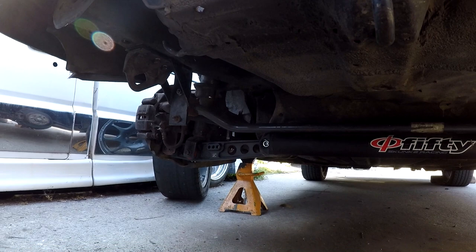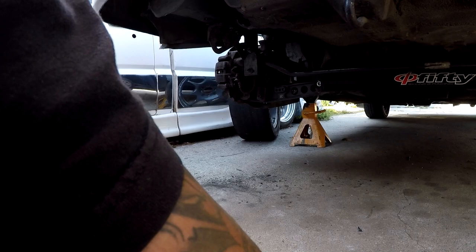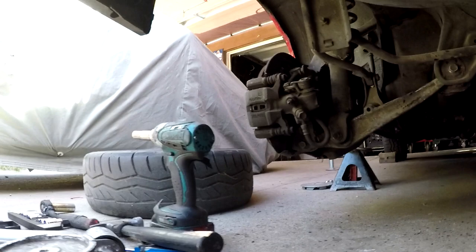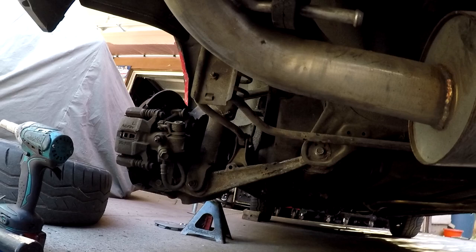Procrastination at its finest — I was on my phone too long and fell asleep under the car for about 15 minutes, but we are done. The CRX drag car got all the nice suspension stuff. I kept the proven shocks stacked up. I got the tow hook installed with the sway bar because this car is going to be on a trailer a lot, so I need those hooks to strap it down. Everything's tightened up and pre-loaded — I jacked the suspension up and then tightened it down so the bushings are already in position rather than twisting. The SI sway bar is on there because all SIs have sway bars.